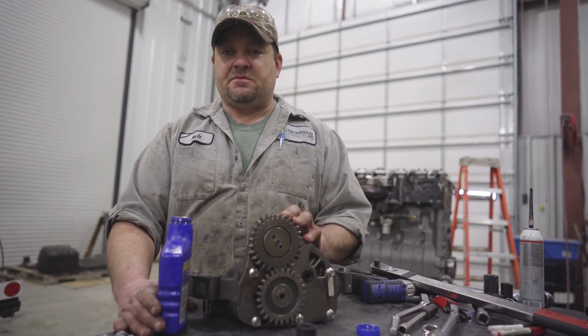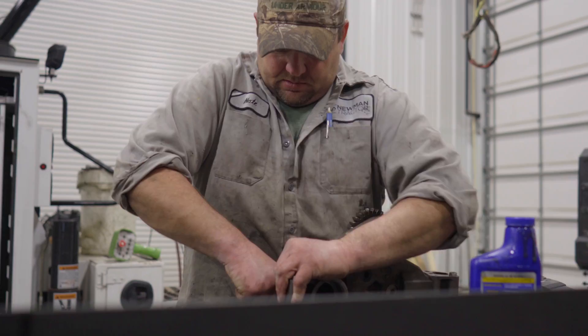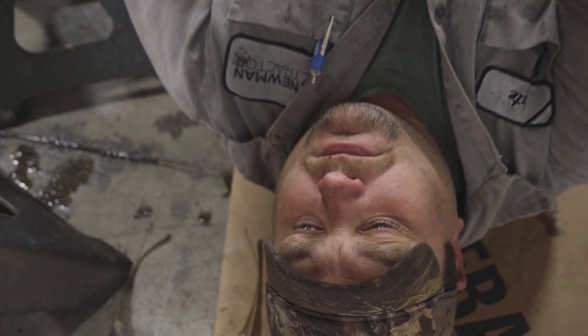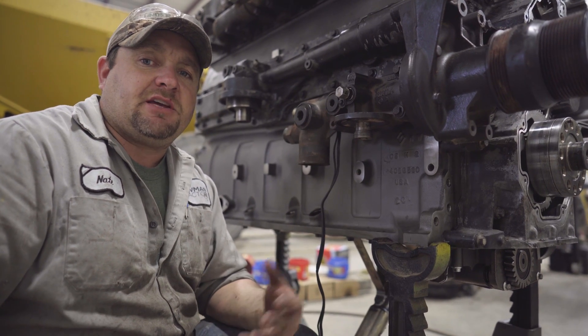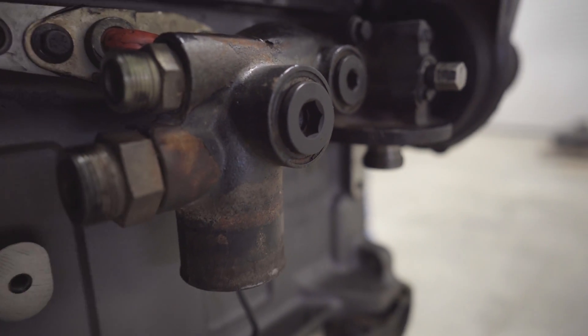It's time to install the lubrication system. This is the engine oil pump, and it's very important to prime your engine oil pump, especially if you've had it apart. What we've just installed is a coolant manifold. In the first episode, we talked about cavitation that can be treated with additive — you screw the canister with additive in, it flows through and protects your cylinder liners.